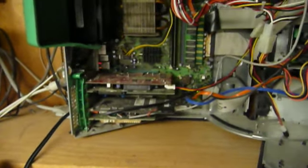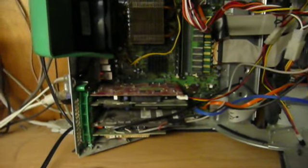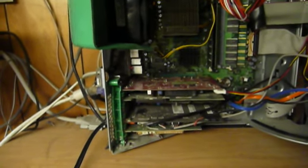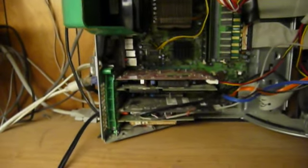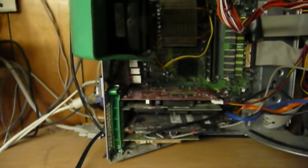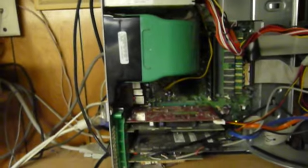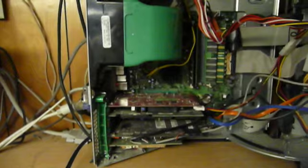Well, as it turns out, both the Windows 2000 and XP operating systems don't support distinctive ringing at all. Although some modems exhibit different ringing patterns or responses in their AT command set if you're watching them through a terminal emulator, this cheap little Conexant Winmodem doesn't do that, so it just sits in there unused as punishment. I have ye old HP OfficeJet Model 500 attending to the faxes since it does the distinctive ringing support in hardware, and unlike a lot of multifunction devices, it can actually receive its faxes to the PC without printing them, so that way I can trash all the junk.